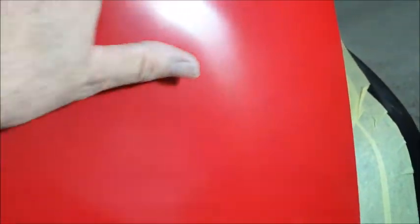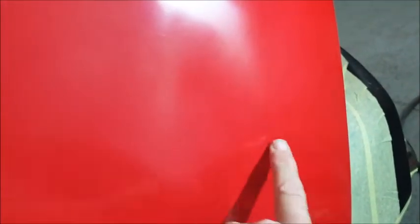When you're flatting and putting flatting marks in, it's sometimes difficult to see the damage that you're trying to get out, because as soon as you put abrasion on, it sort of blends in with the damage that's there. So with the two lights coming from different directions, it shows up the scratches better. And there's one just here which I hadn't noticed, but with the lights off I can now see the lights altered by that scratch that I haven't quite got out.